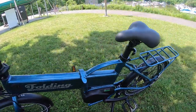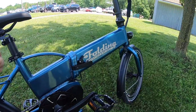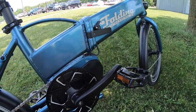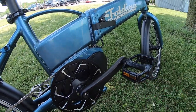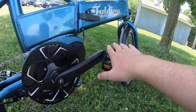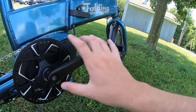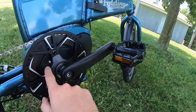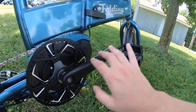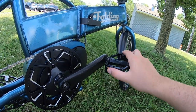With a lot of electric bikes — particularly some folding bikes — you see a cadence sensor that engages pedal assist based on pedal rotations going around a little disc. That's fine for some systems without much tension, like a cruiser, but it doesn't provide the most smooth and natural biking experience that a torque sensor would. On this bike, when you press down on the pedals and put any kind of tension, it reads the amount of stress on the pedals. That information goes through the mechanical system into the controller and sensors built into the motor, which translates it into output through the chainring without requiring the cranks to complete a full rotation — offering a more sensitive and natural riding experience.